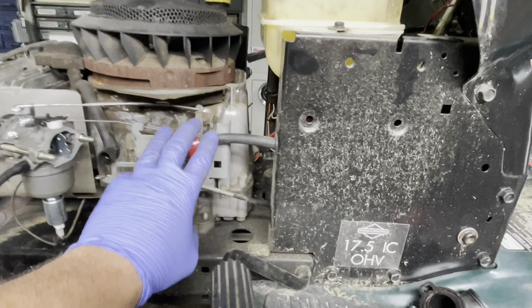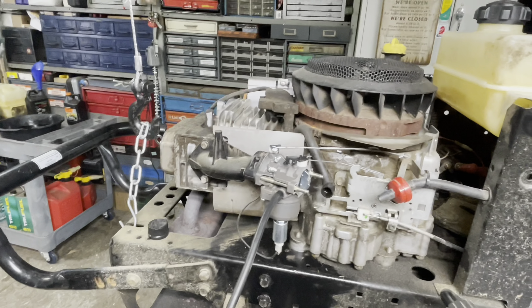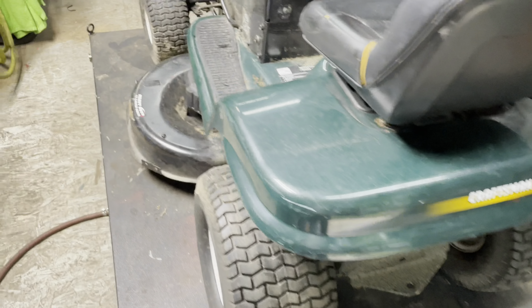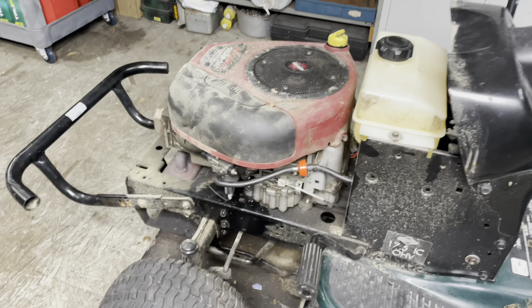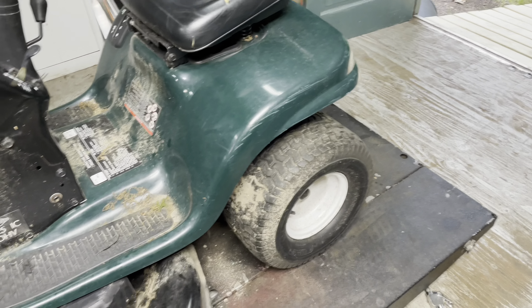You know, my opinion isn't really worth a damn, but say what you want about most Chinese carburetors — the people over at Hippa, they haven't gotten one of these wrong for me. As far as these Nikkis go, this is probably my 10th that I've thrown on right out of the box and it's needed nothing — no tweaking, no adjustments. I'm going to put some new fuel line front to back and probably give this thing a bath.